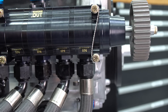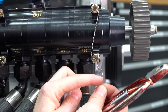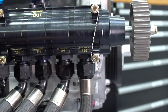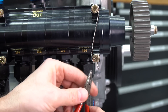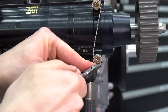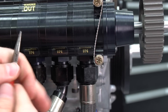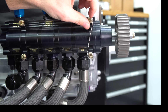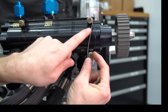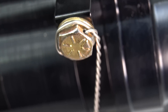Make sure you find all of the little pieces that come off, because especially if you have a race car with racing tires, these can poke into the tire and give you a flat. I've got these little pliers that I love — I'll take this and twist the end away from people working on it so nobody gets cut on that pointy piece. Now it's all safe. If you look at this: if this bolt tries to come loose, it'll pull on the safety wire and won't be able to unscrew while it tries to tighten the other one. If that one tries to come loose, it'll pull on the safety wire and try to tighten this one. So these are not going anywhere. We've got a finished, completed safety-wired bolt setup.